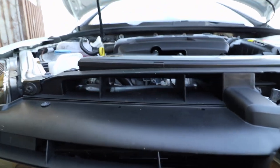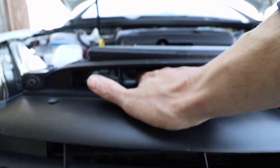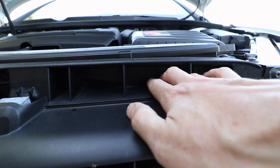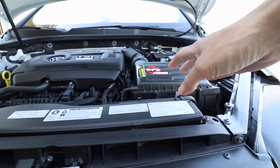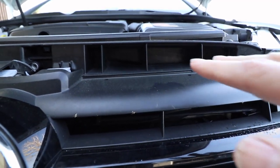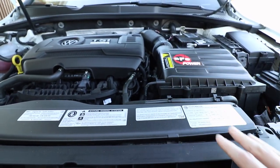This is not something I'm going to be able to do today but I have ordered the part to block off the back of this. What I do want to do is ensure air only comes in from this side — the other side is completely blocked off, which is kind of dumb. People have proven you can cut this out and it doesn't really have a big impact of putting too much moisture into the air box, and then you have a direct airflow going directly into the air box — more of a direct shot ram air effect.